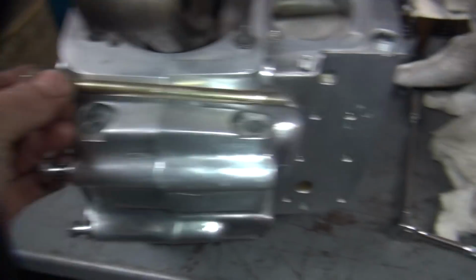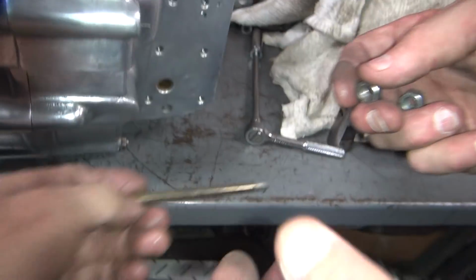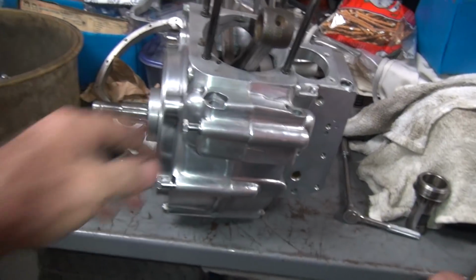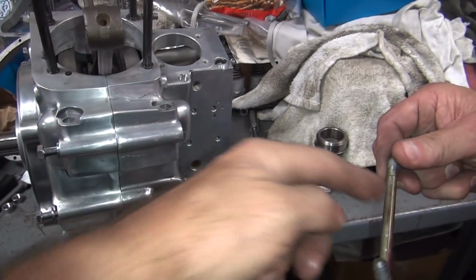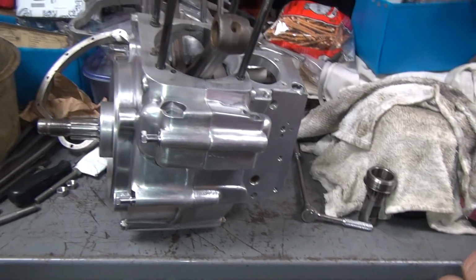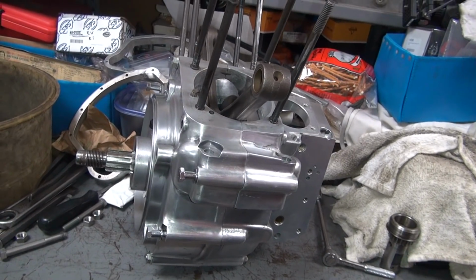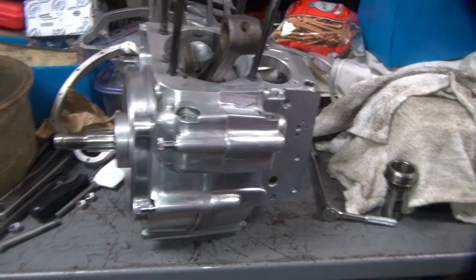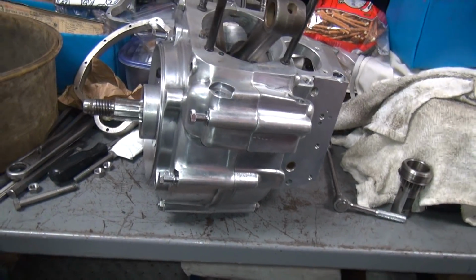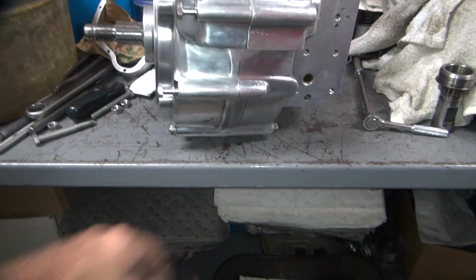So you get all the washer on this side. And you still got a ½ inch over here. Plenty of length. So if you drill this all the way through, you can do that, and then we can probably cut that one. That's a grade 8 there, so it'd be pretty strong. So that would work, which is probably the better way of going anyway. I always like 3 bolts over just a single bolt side. But you do need to come up with that stud for the bottom.